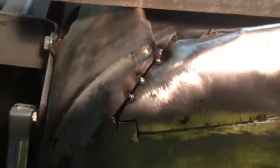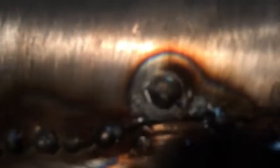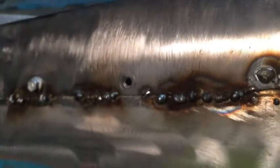Got the quarter panel cut and just tacked in a little bit - you can see a few tacks. Looks to fit not too bad, so I'm just going to keep tacking it all the way around, weld it in and see how it looks. Just to show what I'm doing - I'm just plugging them up as I go, like that. I might try and weld one with the camera on and see how that goes.